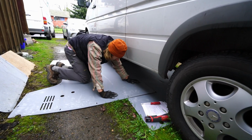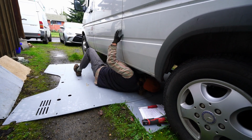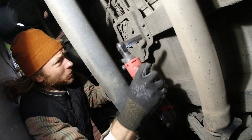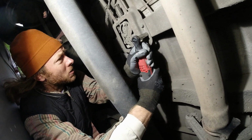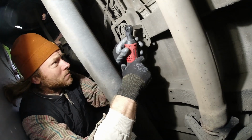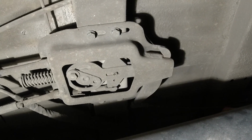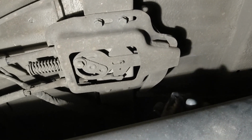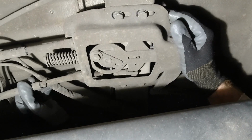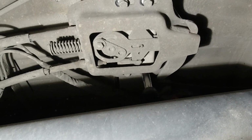You know, these old van walls make great ground mats. Nice and clean. So I'm going to loosen these 4 bolts. 1, 2, 3, 4. They're 13mm. Just to loosen. So we got our 4 13mm loosened up. I'm going to slide this whole assembly towards the rear of the van. Should have brought a little mallet. I'm going to loosen up just a little more.